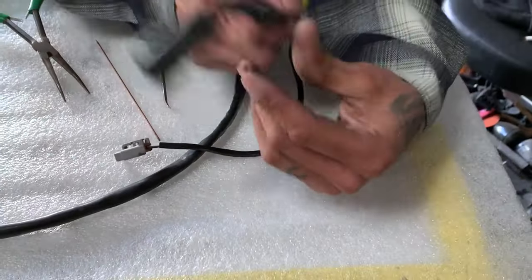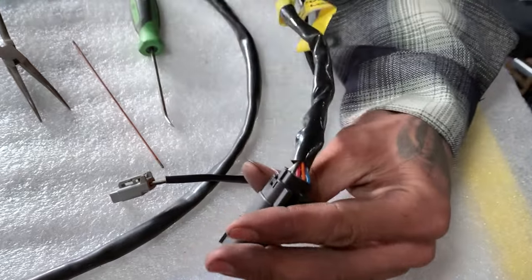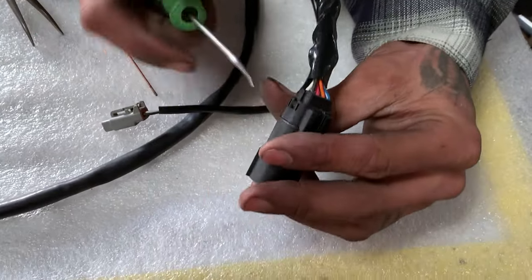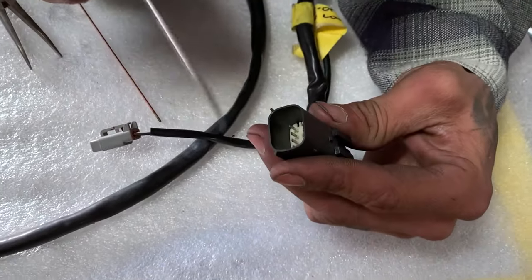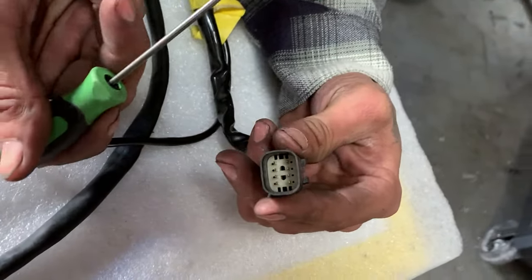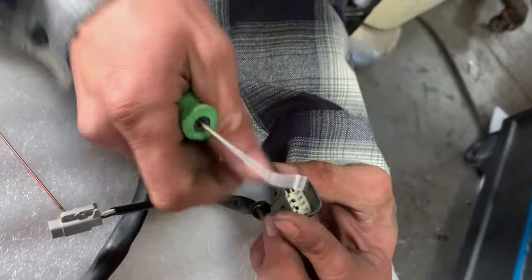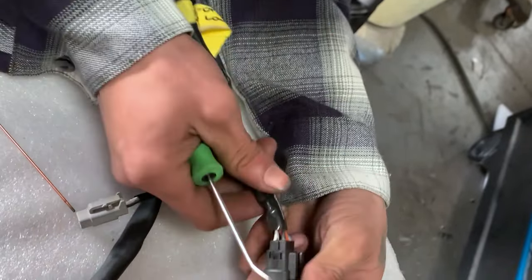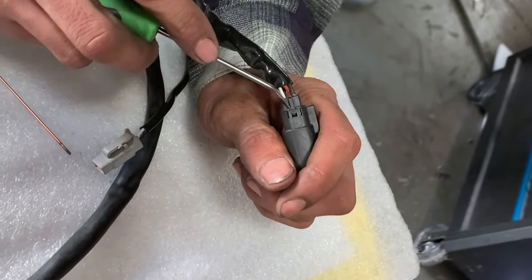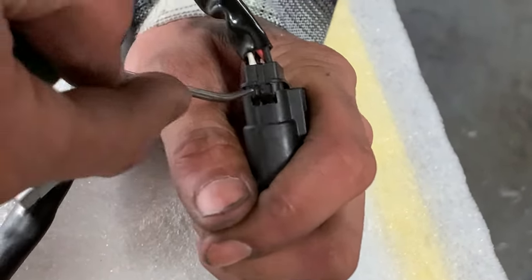The last one is a very common one on older bikes, especially older baggers. Take this pick — it's similar to the Deutsch plug in the lock it's got. You have to release it from the inside though; you can't get it pushed out or pulled out from the outside, you'll just either break it or keep slipping. So just take a little pick and pop the side out.